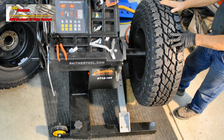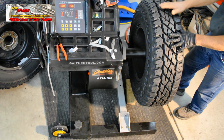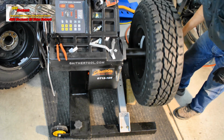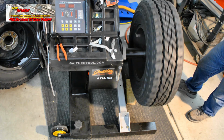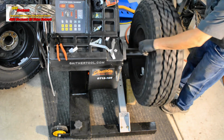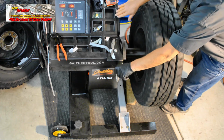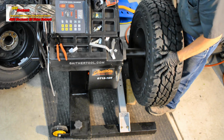Again, these are our wheels and tires. This is our balancer, and we're in a position to, if we need to, after slight wear in of the tires, give them a chance to round a bit, we'll rebalance. Okay. Well, it's calling for 0.3. We're going to go ahead and put 1/4 ounce in that location. We're starting to creep up there a bit.